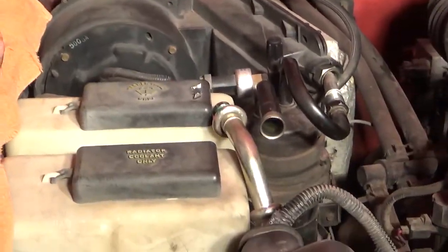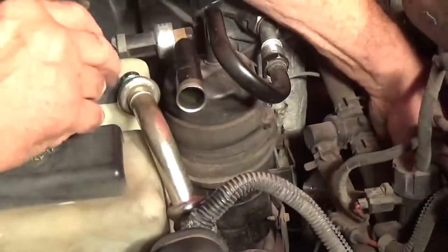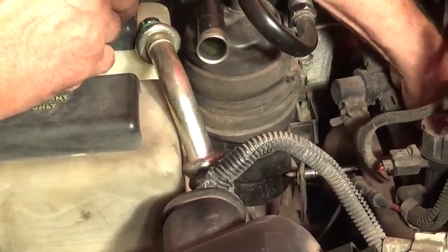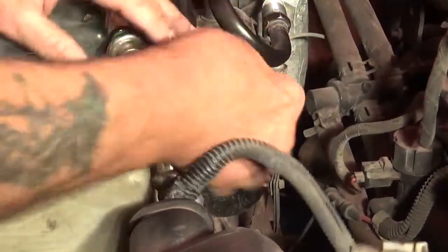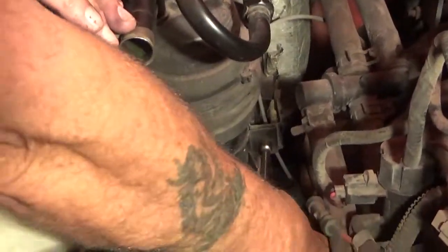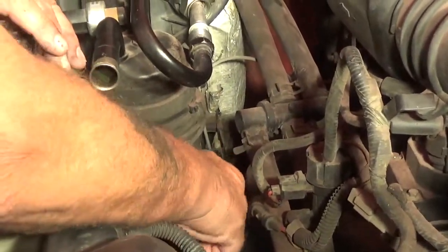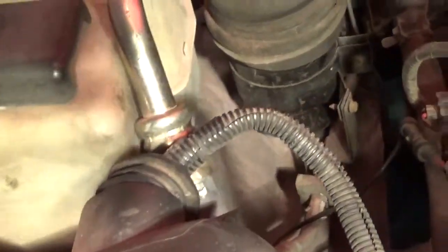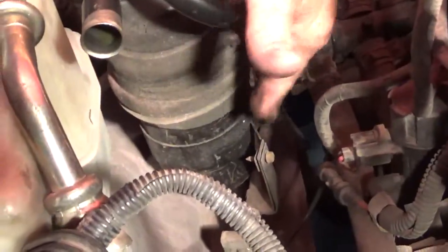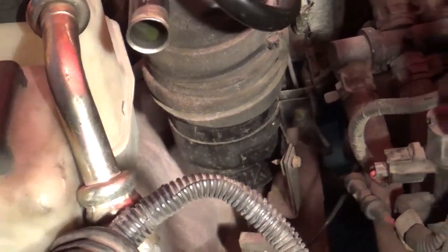I typically take these apart before I ever take the bracket down here loose, simply because it stabilizes the accumulator so I can work with it. If it's sitting there slopping around in that clamp, it's awfully hard to break loose. So I'm going to stick my little wrench in there — that little 5/16ths down under there. You can see the screw right there very clearly. I just simply back this off a little bit to loosen that — that's the one that holds the whole bracket in place. The other one right here actually clamps the cylinder.